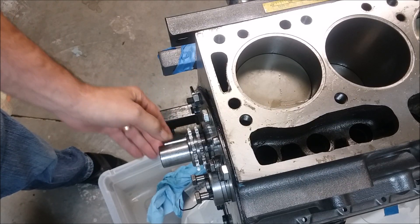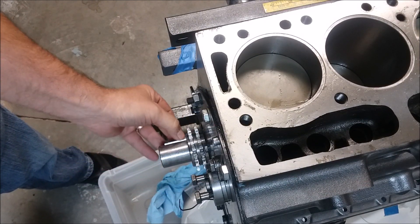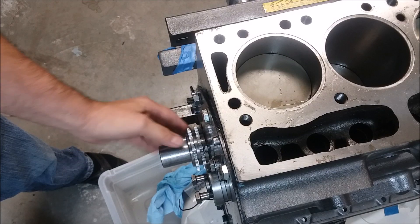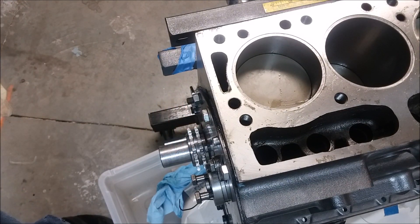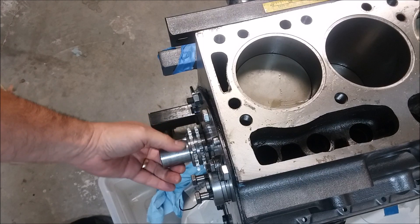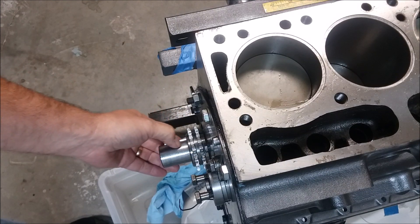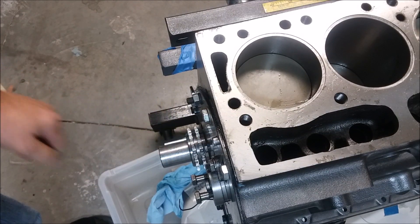I think the problem was caused by two things: the first part of the travel was caused by the nibs on the crankshaft, and that last bit was caused by when I — and the machine shop — tried to remove the Woodruff key. I think we rocked it a little bit and brought that end up. That's why filing the back end of the Woodruff key made it possible to move the crank gear again. I appreciate your comments — if I did something wrong with the Prussian blue or whatever, go ahead and let me know how you would have done this differently. Subscribe to the channel, it takes a long time to make these videos, and if you're working on yours, let me know how you solved this challenge. Thanks for watching.